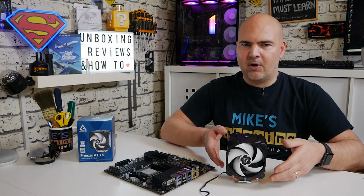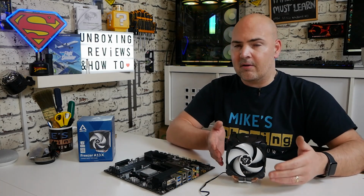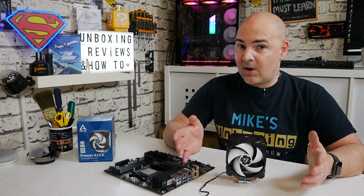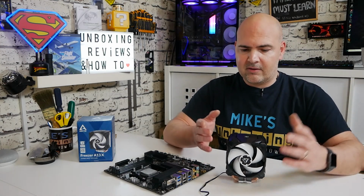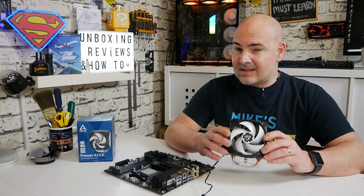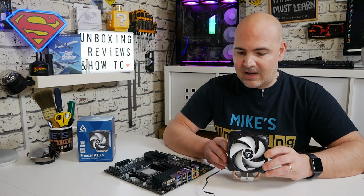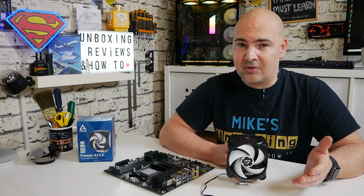Yes, it's only got 3 heat pipes, it's not going to be great. Or it's only got a 92mm fan, it's not going to be as good as a 120mm fan. But actually, if you take a look at some of the testing I've done from previous videos and look around on the internet at various things, this is surprisingly close to a lot of the really good competitors. And the fact that it gets within even 10 degrees of a 360mm AIO is a testament to Arctic's engineering and abilities. So as much as I didn't want to, I've got to recommend it. It's actually a really decent cooler.